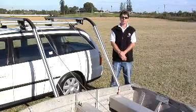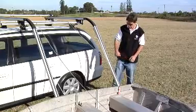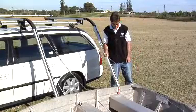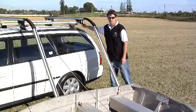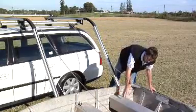You're almost ready to load your boat, but before you do, let's just do a quick safety check. Ensure all ropes are running on the inside of the ramps with no tangles. All knobs on the lower half of the ramps are tight, and the ramp holder brackets are tightly secured. Also make sure no one's left anything loose in the boat.